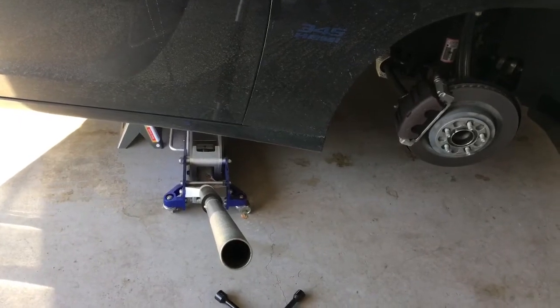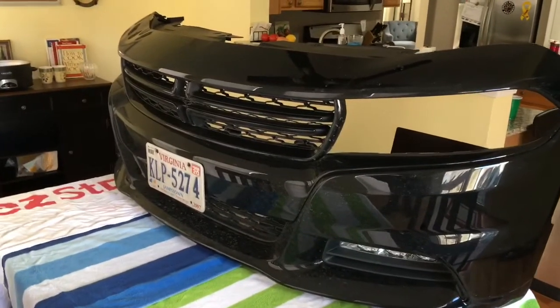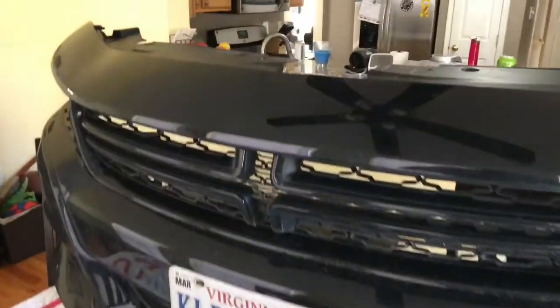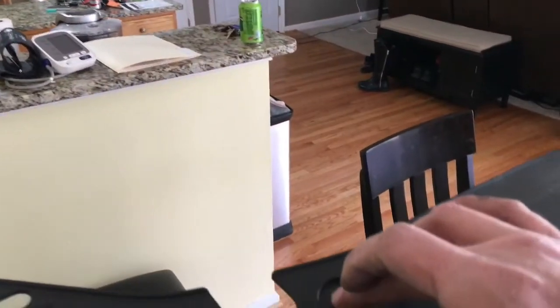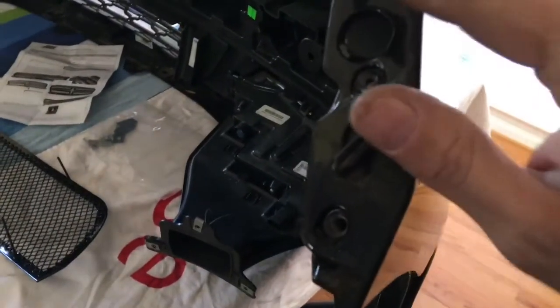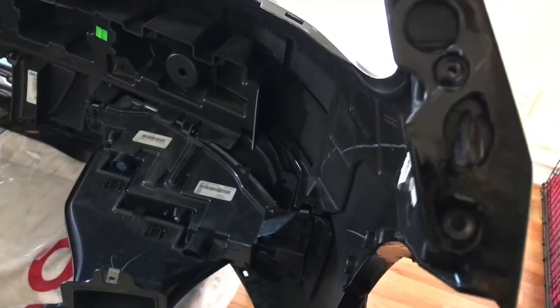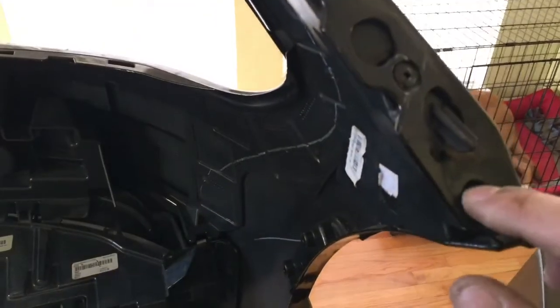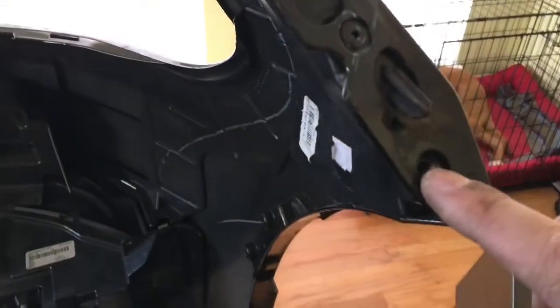Both jack stands were looking pretty stable, so we're gonna go ahead and start removing the bumper. There's nothing better than your front bumper sitting on the dining room table — I don't recommend this unless you put towels down, or you'll be sleeping on the couch. You'll need to remove the clips up at the very top, then the slides that go into the front fender, and your 10mm bolts: one comes from underneath the hood, and the other two require removing the fender well to access.